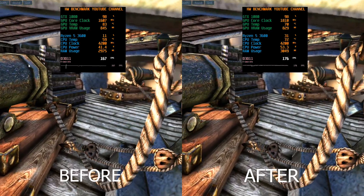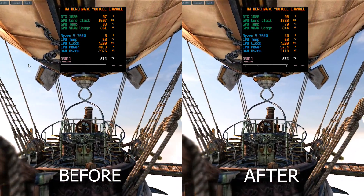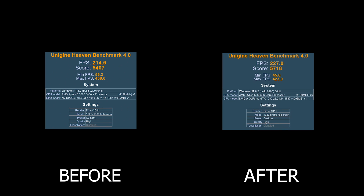As for our average FPS, it's 227 FPS versus 214 FPS — that's about a 6% difference. Six percent might not sound like much, but it didn't really cost me a lot — maybe less than ten dollars max to get that 6% improvement. So if you have a GPU that you haven't cleaned in a while, or if you just bought a used GPU, make sure you clean it first, replace the thermal paste and the thermal pads. It won't cost you much and you may be able to gain some performance and better thermals.